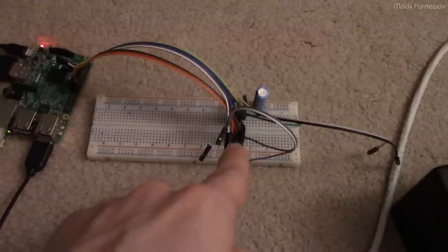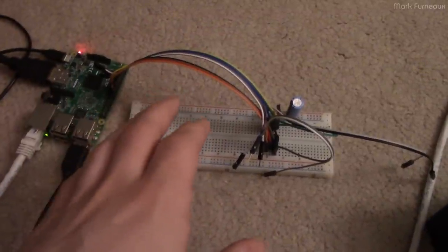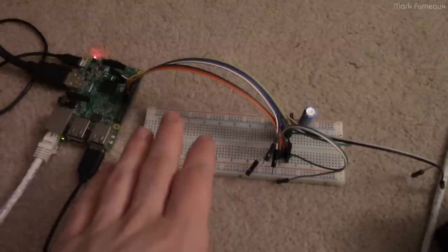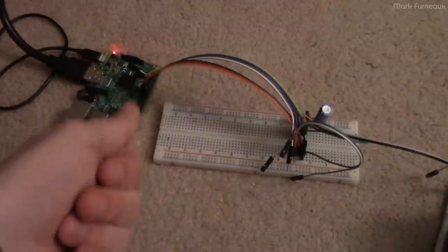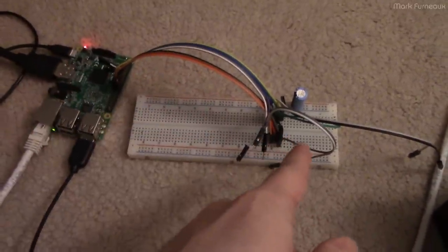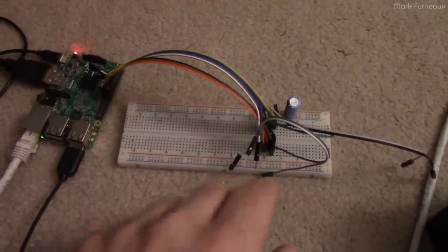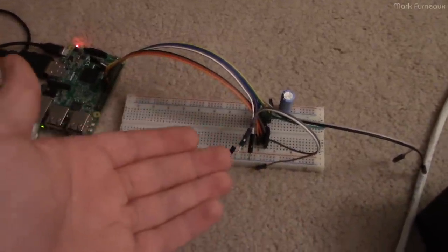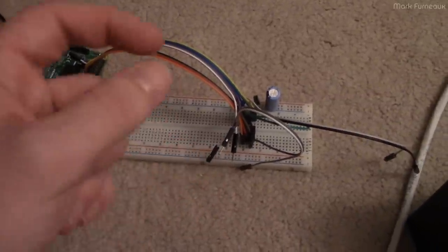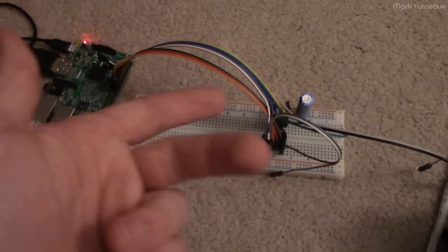Some people say you can try to program the chips while still in the motherboard — I would not recommend this for two reasons. First, as soon as you apply power, everything on the 3.3 volt rail is going to try to suck power, and the Raspberry Pi will not be able to power that — which could destroy the regulator. Second, if you try to turn the motherboard on and connect this, you don't know if anything else is trying to talk to the chip, and you could end up with programming or reading errors because two things are trying to talk on the bus at the same time. So it's better to just take the chip off. If the chip is soldered on, you can easily take it off with a hot air gun — those are very cheap now. You can get little carrier boards to solder onto to make it a DIP so you can put it in a breadboard.